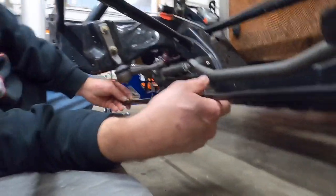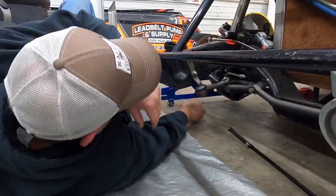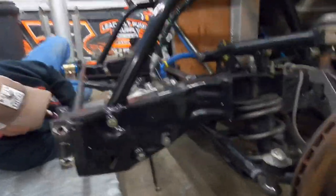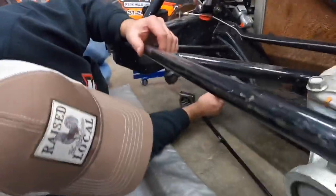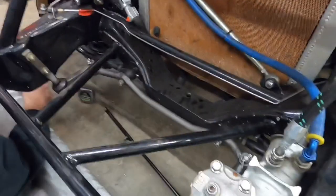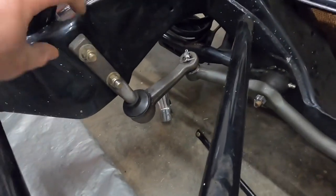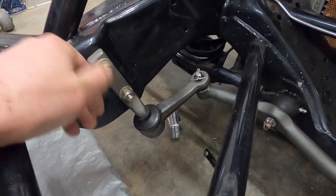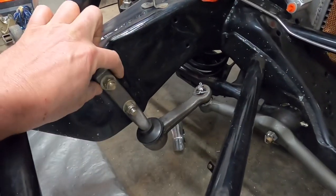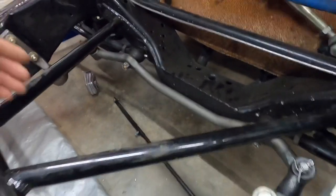He's a retired quality guy — talking about five-thousandths. So here's what happens: say that was off an eighth of an inch or something and this was too narrow. The only thing you can do is zip down the sides of both sides of this idler arm mount, push that back, and re-weld it back in. Or if it's too wide you can space it out. That would be your first step in starting this toe deal.